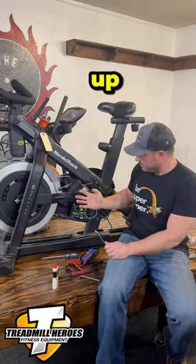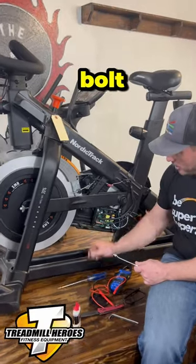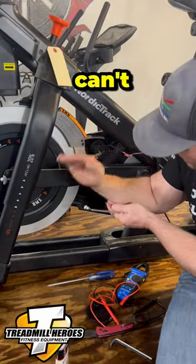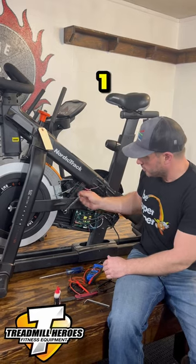Open this thing up and get the plastic covers off. Right here is a pivot bolt, right down there. That pivot bolt can sometimes be too tight, so it can't pivot smoothly. Take that pivot bolt out and then take yourself some three-in-one oil.